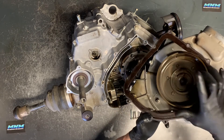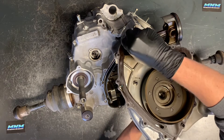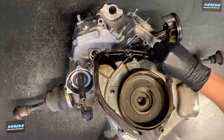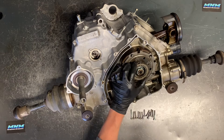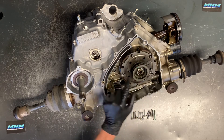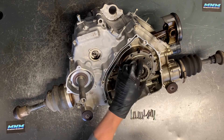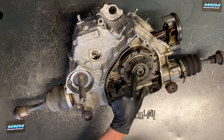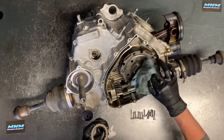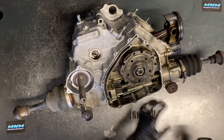There is your centrifugal clutch and your centrifugal clutch housing. I'll let this sit on the bench and drain the oil out of it. Here's your gasket — make sure you get that replaced every time you tear into this; clean it up really well and put a new gasket in. We've got your one-way bearing here. If you order a stock one — which I'd suggest — the arrow will be going clockwise, it'll say 'outside,' and it'll have a green dot. Inspect that really well; make sure there are no flat spots or damage to the bearing.